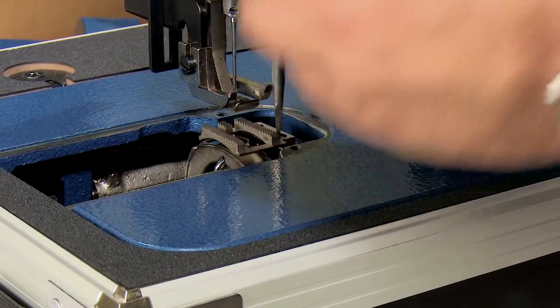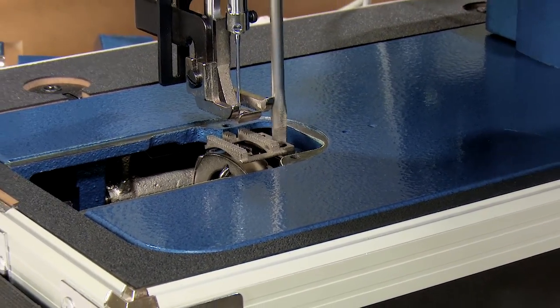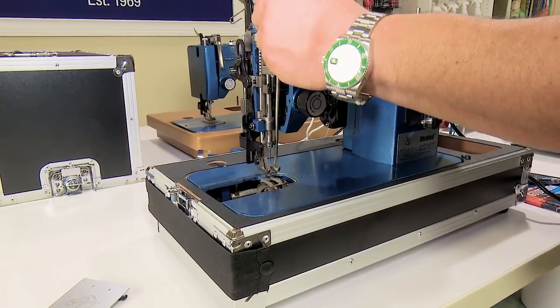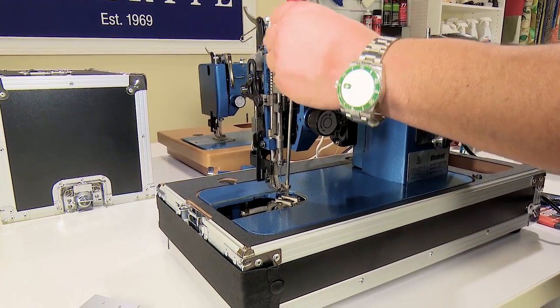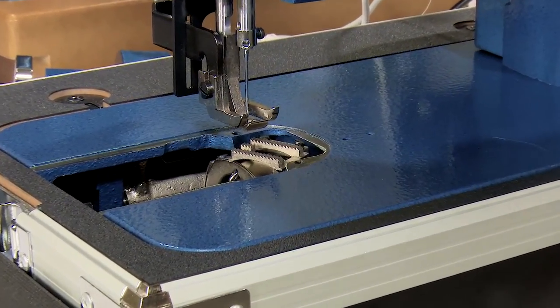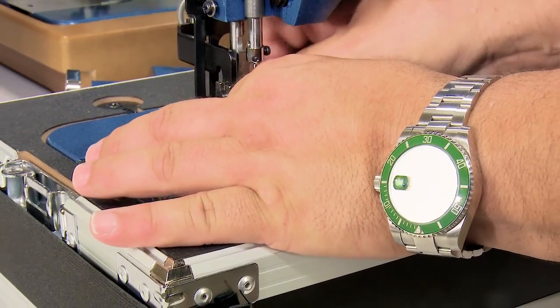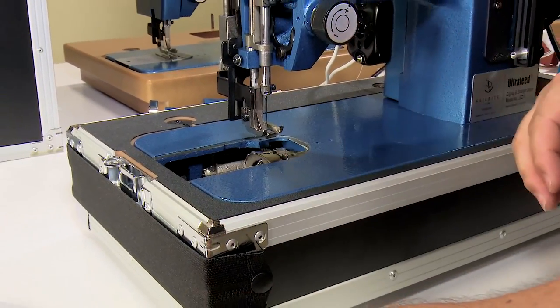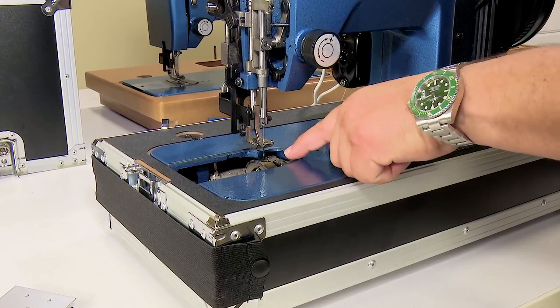And the feed dog, there are two screws to the right of it. This one you want to get good pressure down on it so you're not slipping on the screw heads like I just did there. And then you can generally come in either from the front or the back to get the back one. If one is really hard to release, go to the other one, try it before, and then often when you get one released, then the one that was being stubborn will release easily. Set those aside.